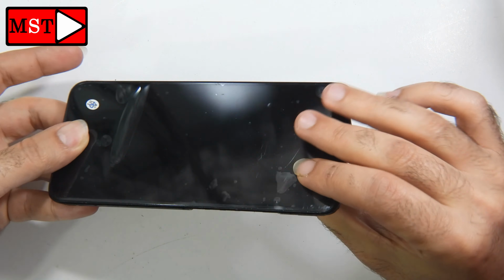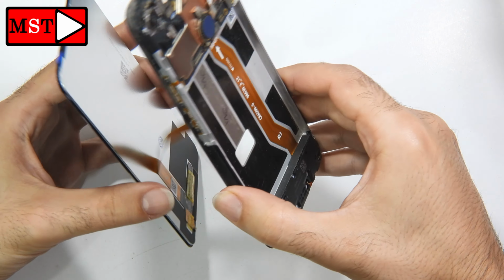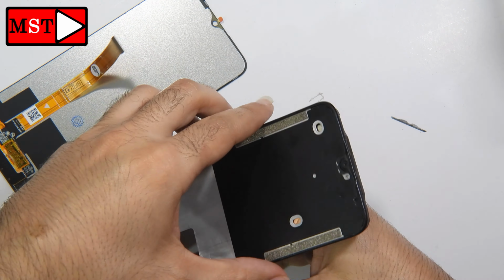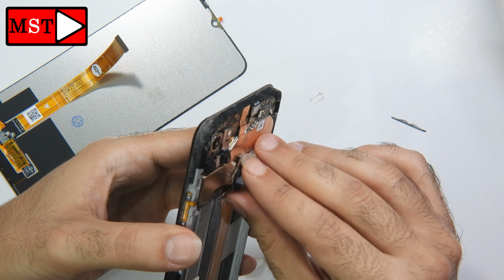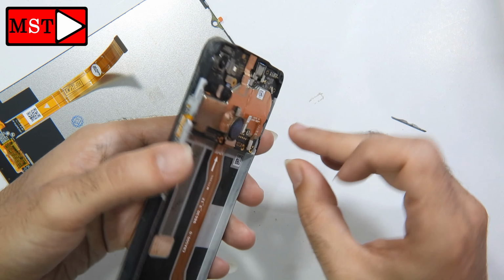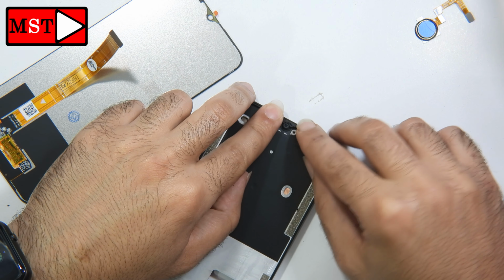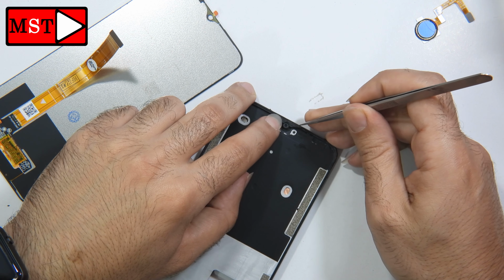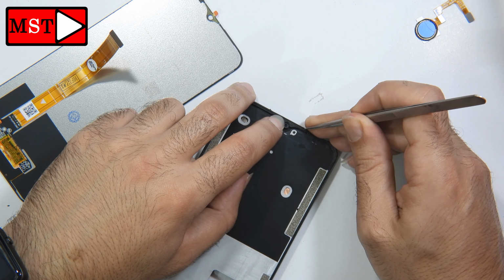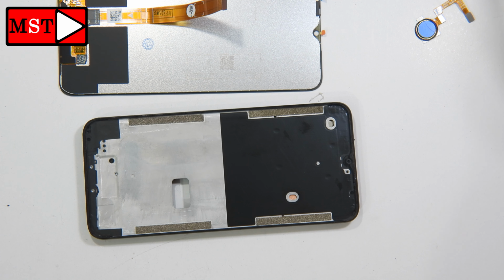Sometimes the screen could be damaged. I'm checking if the screen is fitting without any problem. I have already turned on the device and tested the screen. So now I'm going to proceed to put the adhesive, the glue, and then I will assemble the screen in position. It's important also to put the ear speaker shield in place because we don't want dust or anything going into the ear speaker and then to the camera.